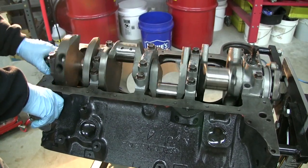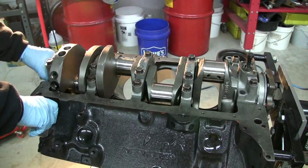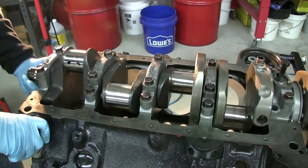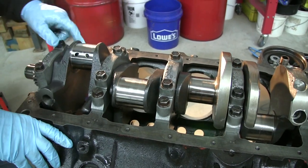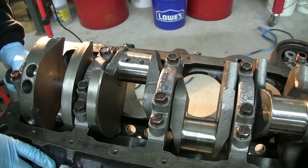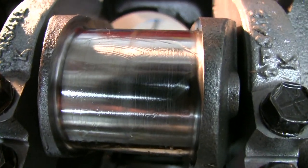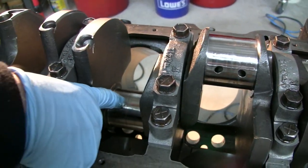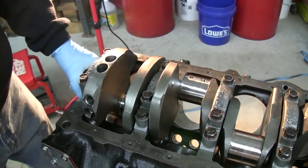The crankshaft runs really freely and nice and smooth. Got the mains marked. We'll take a closer look at the crank and go ahead and pull the mains off. It does spin freely and easily - that's a good sign for me. I see a little bit of scoring on the crankshaft too - almost nothing, maybe just a very light polishing. I think the bearings actually took all the metal and spared the crankshaft. They did what they're supposed to do. A little scoring right here, but it's so light it's not even going to be measurable. I think we have a good crank. Alright, let's get it out of the block and see what it looks like.